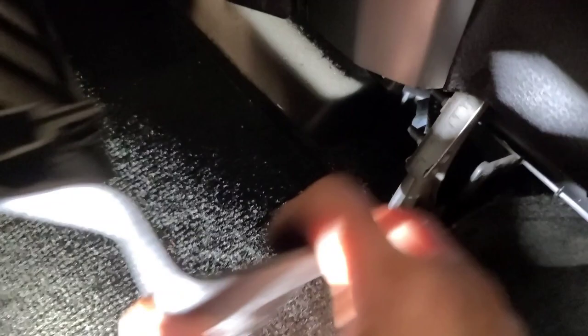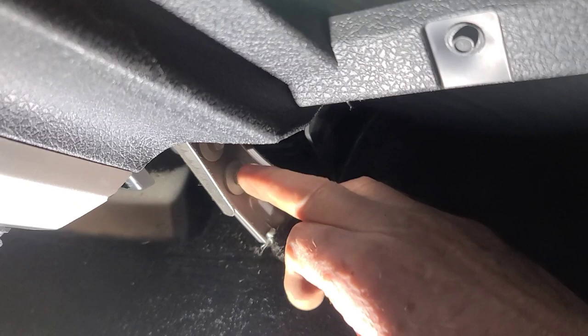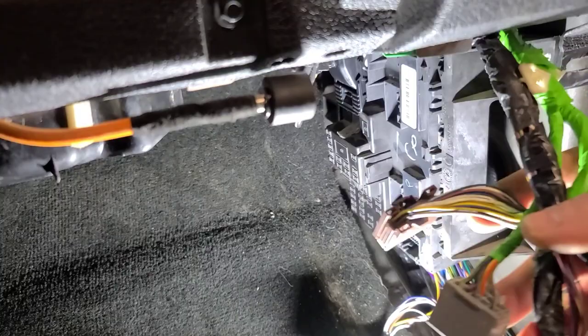Remove that piece and pry it out — it's got two plastic clips on the top. There should be some bolts in the bottom of the column here, two on either side. Disconnect the airbag and the antenna connector, then one, two, three, four, five connectors from the BCM, and unclip the harness from the attached BCM — that's going to stay with the dash.